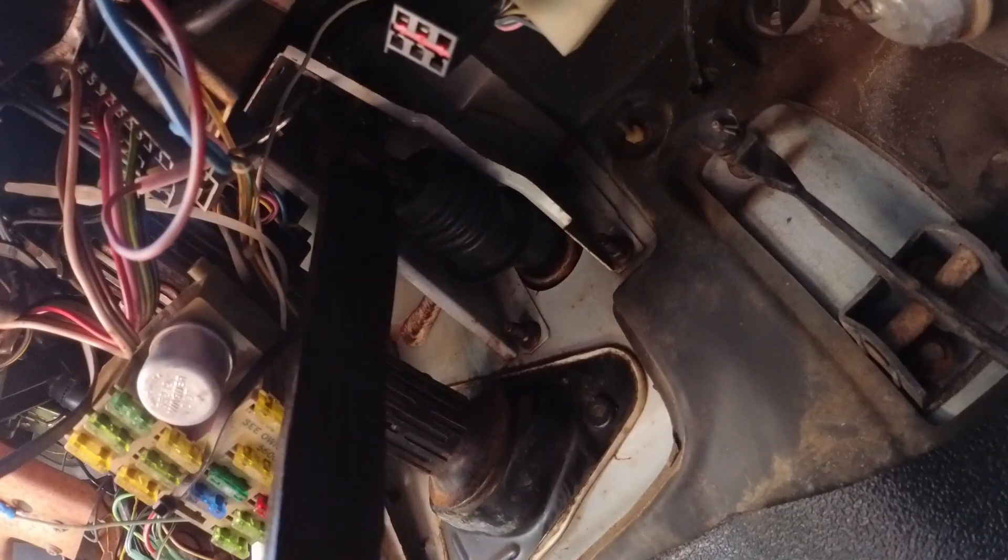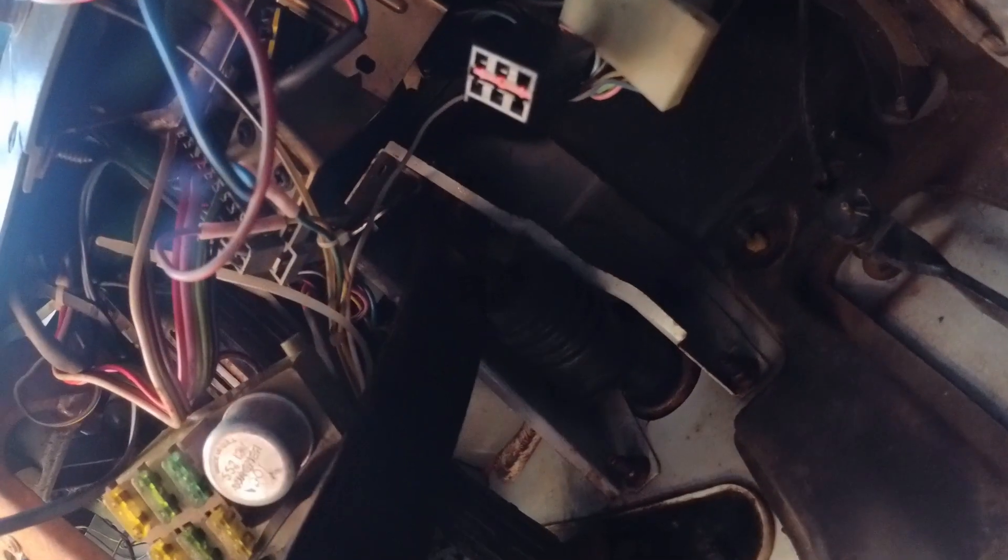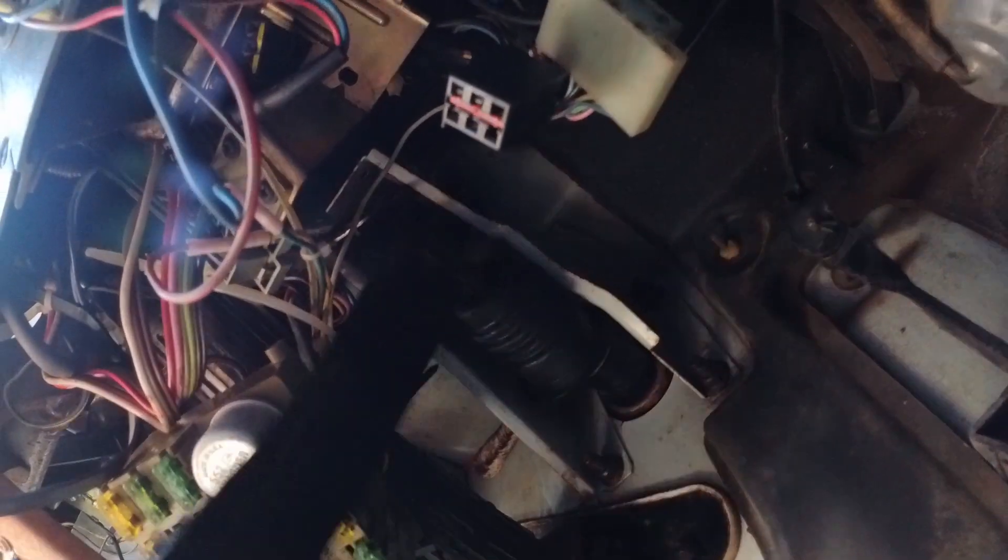Inside the booster is a rod, and attached to that rod is a retainer that's supposed to prevent the pedal from coming out too far. The pedal was getting stuck because up at the top there's a rod that runs clear through and also attaches to where the clutch pedal would be. It's old, it's 1990, it's rusty — so the pedal wasn't returning, and people were pulling on it to get it to return, which was bending the bracket and causing the brake light switch to turn on. So we're going to end up replacing the booster.